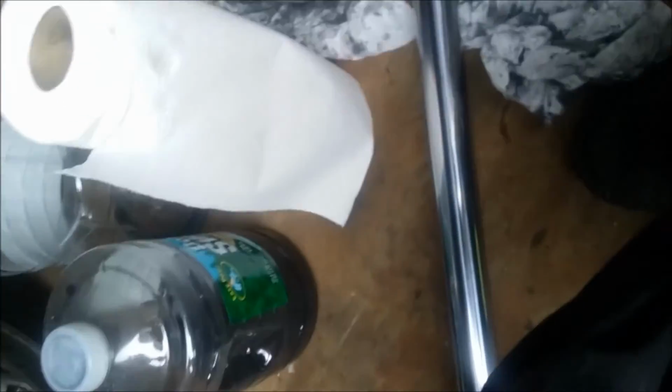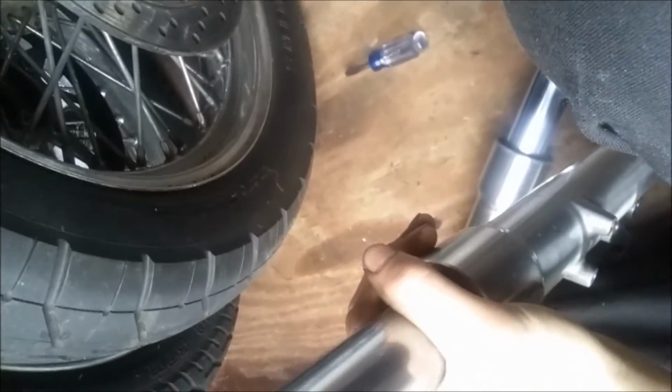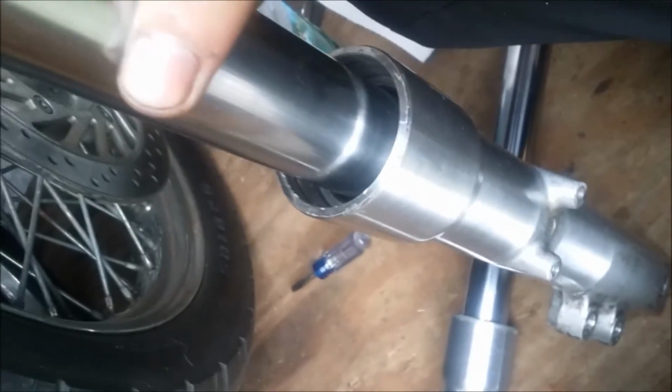So we have our bushing here. Also, on top of that goes the washer, and then you have your fork seals. You should be using a correct method for this. Rather than buying a seal driver kit, which are kind of expensive, the best way is to take some waste pipe like this, cut it much shorter than this, of course, probably in half, cut it down the end, and get a muffler clamp. Put this around the end so it would obviously sit down over this, and clamp it, and then you can use that action to just pop it down into its recess.